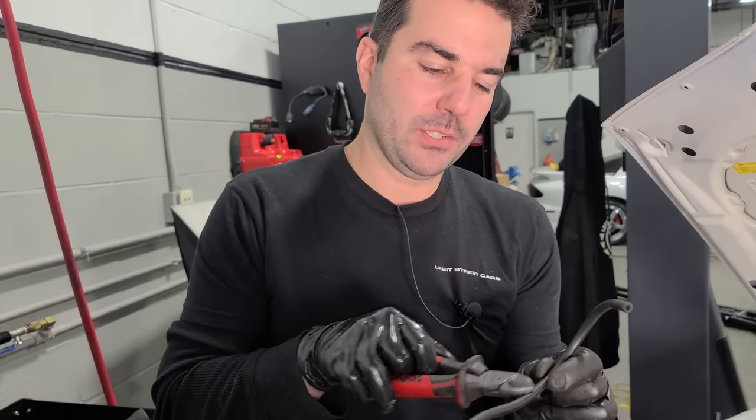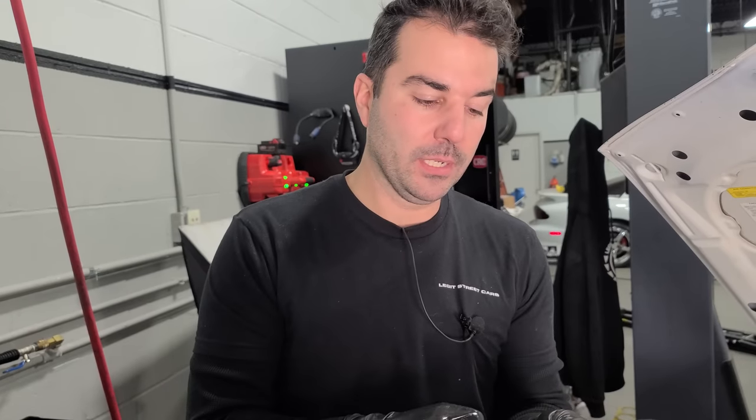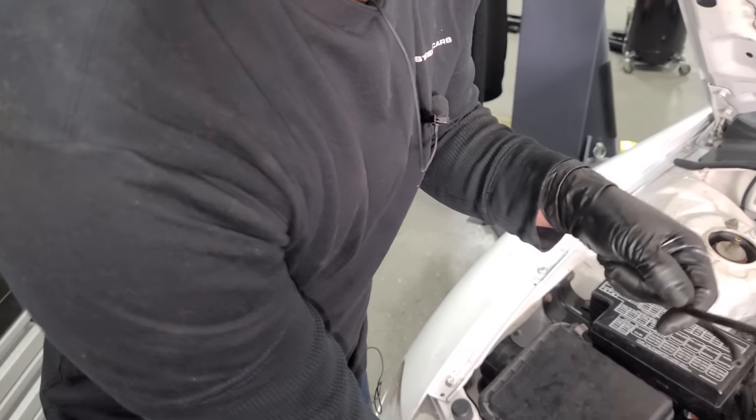Okay. So if we wanted to be super hacky, just normal level hacky, we would make a little slit with a razor blade in this line and it would bleed off boost, which would then require the turbocharger to work harder to create the proper amount of boost to open the wastegate. So it has a spring in there that's set to a specific boost pressure. So that's how you make more boost. But what we're gonna do is not that hacky. I mean, come on now.